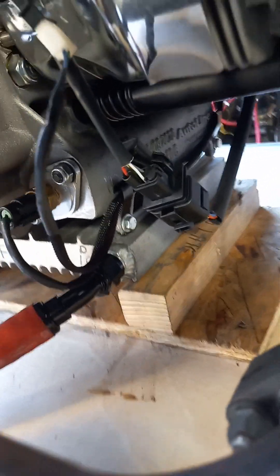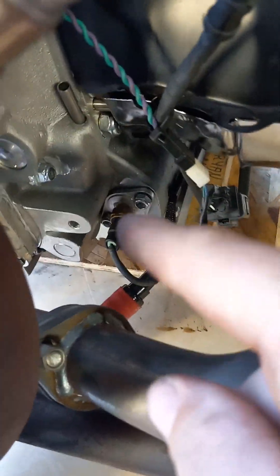Too bad this is all taped up. It's running bypass oil control — that's where it returns back to the sump, that little blue tape there. I have the turbo drain going back — I'm going back to the sump. I'm using the type 3 location for the dipstick or for the temperature sensor for the fuel injection.